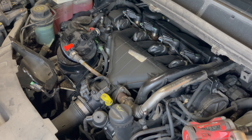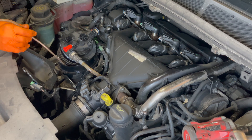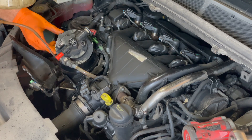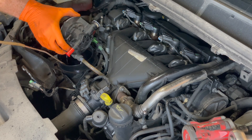What I'm going to do is suck the old fuel out, because a fuel filter on a diesel engine is actually really a water trap — it doesn't filter the fuel, but it gets the water out. So you can use the vacuum bleeder to achieve this. It's ideal to get as much of the old fuel out as possible, and any water. This is actually a brake bleeder, but it's very good for this.